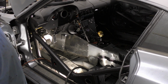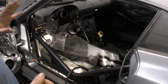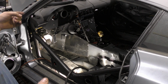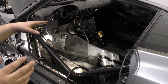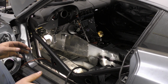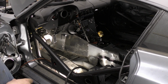Next one in, probably, maybe we'll have one for the fuel pump, because the way I'm doing it, I'm doing a staged fuel pump system. The first pump will run off the Holley, and then the second pump will be flipping a switch on the dash, which will also act as the scramble button. Essentially I'm going to keep it at about 5 psi, whatever a wastegate spring is, and that will be enough to be fed by just that one pump. So as you're just cruising around, we just have the one pump. Then we'll hit a switch, it'll engage the scramble, push it up to 14, 15 psi or so, and kick on that secondary pump.